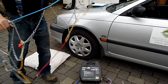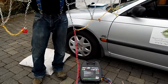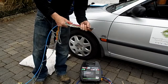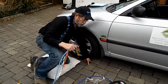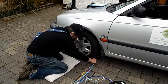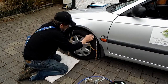Which is, you want to then hold it up, make sure everything's angling down like it's supposed to and there's no kinks, and see, that's not good there. And then take this one like this, and this one, and get a little bit of masking tape or something, or black tape, or a piece of wire, coat hanger, and hook it onto the end of this. I'm talking if there's snow on the ground, it's a lot harder. Push that around, and then you can just grab the other wire and pull it on around like that. Some people sell that as part of their kit, a special tool to help push that wire around. Again, hook the clamp up there in the back.